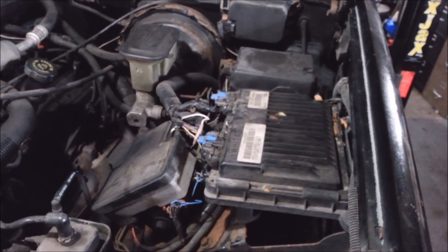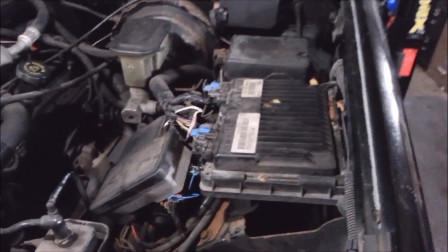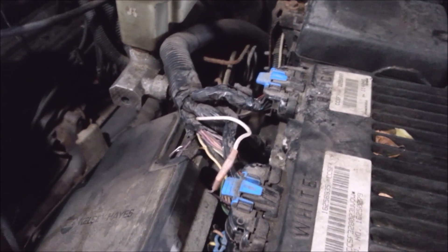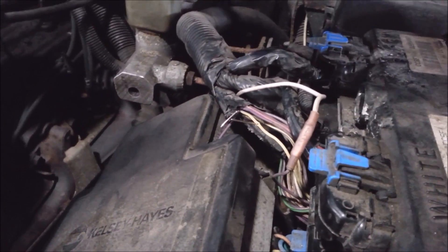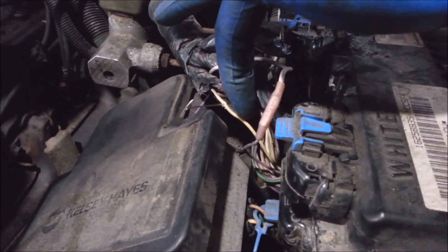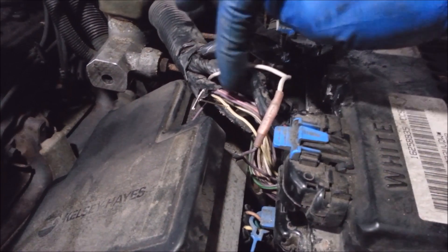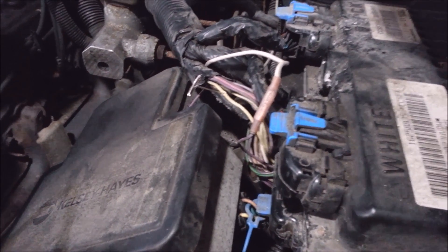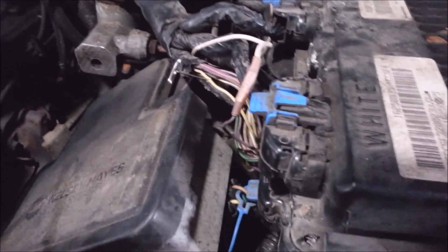Regardless, I'm going to replace the crankshaft sensor in here — I think it's already been done once too, just from the looks of this. I'm going to go through what I do to diagnose these things. First thing I did was check the signal. The biggest reason why I poked this solid yellow wire is because I wanted to check continuity from the sensor connector to this wire, just to make sure the wire wasn't broken — and it passed.